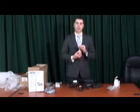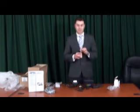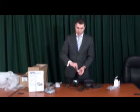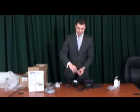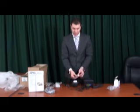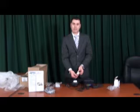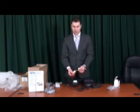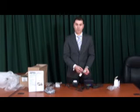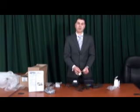The filter will generally help this signal 9 times out of 10. You simply plug the filter into the splitter, and then the phone line into the filter on the side where it says phone, not DSL. From there, the splitter is plugged back into the outlet in the wall, and their phone or fax is plugged into the secondary port.